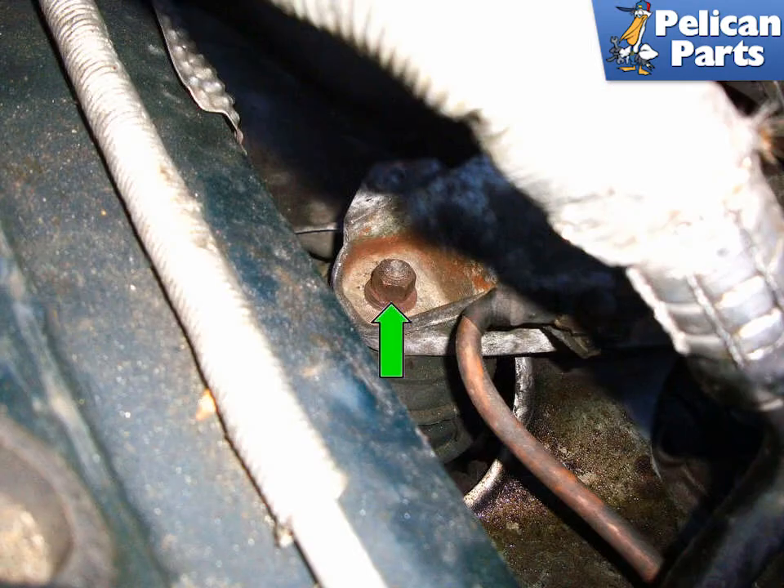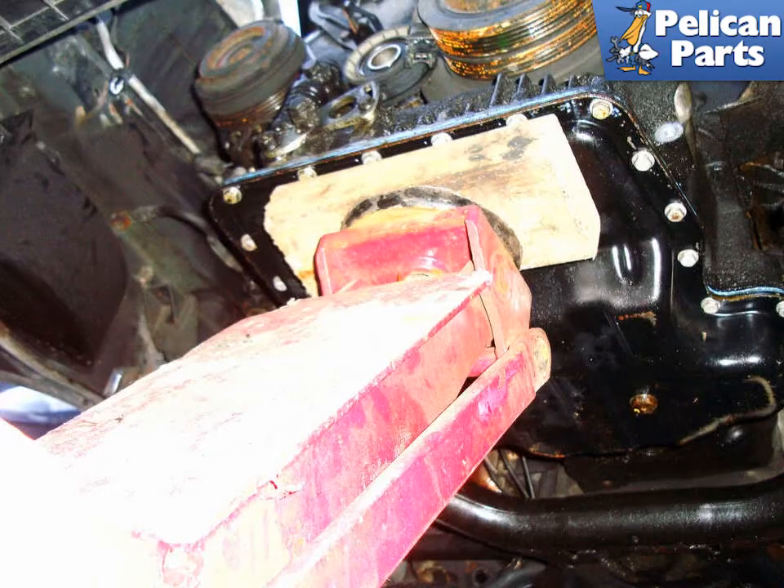This image illustrates a motor mount on the right side of a six cylinder engine. You can see the bracket and its position is almost identical to the eight cylinder model. Remove the 16 millimeter fastener that holds the engine bracket to the top of the mount. Place a wooden block between your jack and the pan to protect the pan.